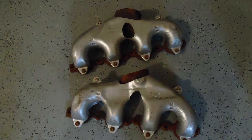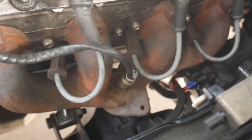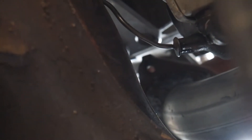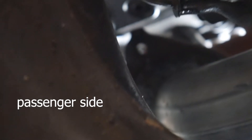I don't mean perfectly on the passenger side — the passenger side is extremely easy, you can just do that blindfolded. But the driver side is really tricky because you have to maneuver the headers piping through the power steering box, and between there is a tiny gap. Basically the C5 or the C6 exhaust manifolds fit perfectly.